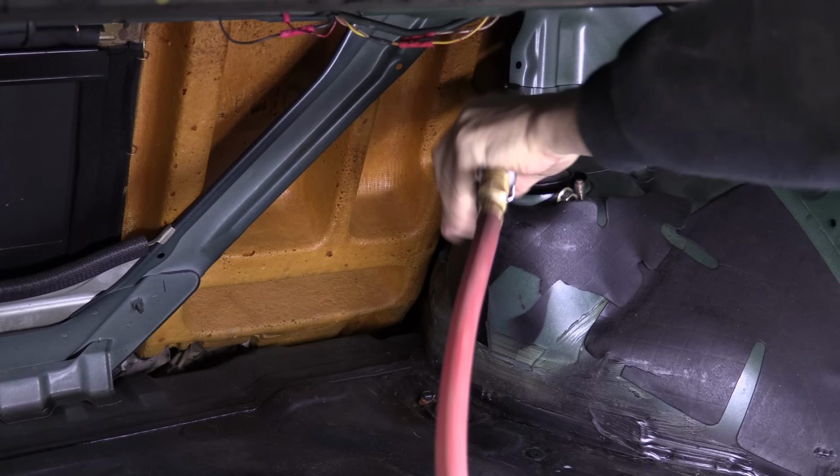The difference is really only 1 mm worth of axle shaft, and the four-bolt rear differential has a viscous limited slip option. But all this equipment is the three-bolt open diff variety. Some split hairs about the efficiency of the smaller, lighter three-bolt driveline parts, but I never do that. I'm more concerned about durability. Three-bolt stuff is fine for small turbo builds. Heck, they lasted 158,000 miles on this one. If you can see, there's nothing wrong with any of it. But with the cups separated, there's only four bolts holding the rear diff housing to the K-member.